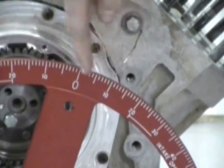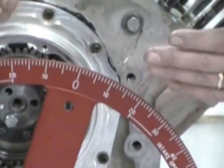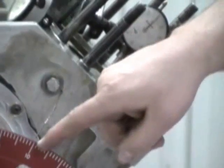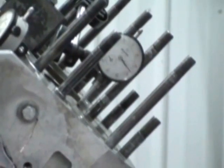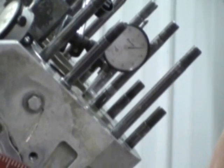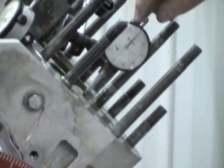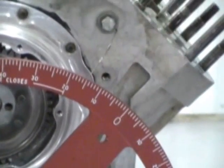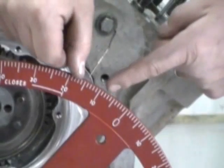What we're trying to do is find exactly where we split the difference. We're at zero there, 10 degrees here. The piston's coming up, goes past top dead center, goes all the way back down to zero — right there, zero. Now the pointer is telling us that we're at 15, so we're five degrees off.